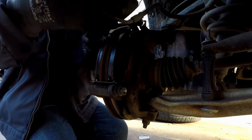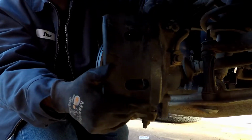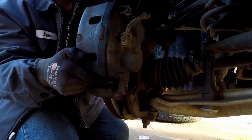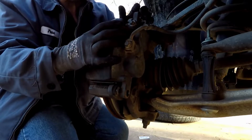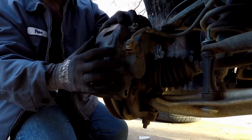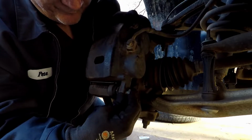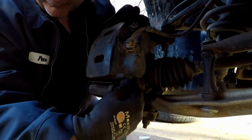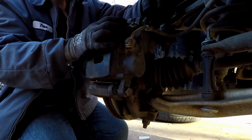And once you get that done, make sure your sliders are going in and out properly, put the tab against the slider, pull in on it, slide that on like such, slide it up on your brake pads, take your other finger, grab that slider and push in on it, and now that goes on like such. All you gotta do is just line up the holes, and that is super easy. Right there. There's that one, and there's that one. Now you just run them in and tighten them down.